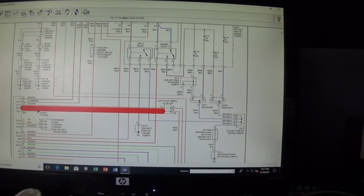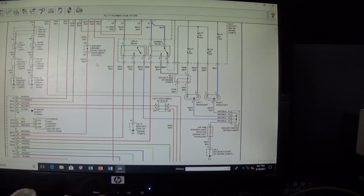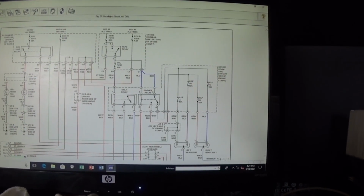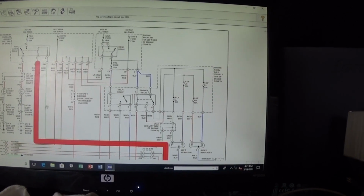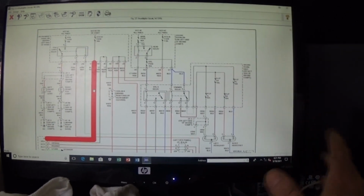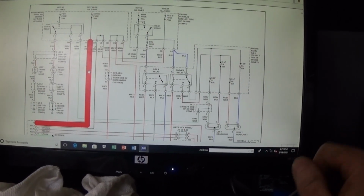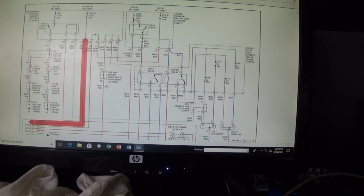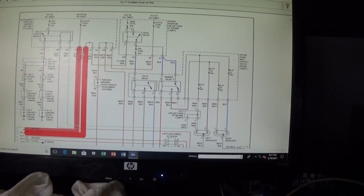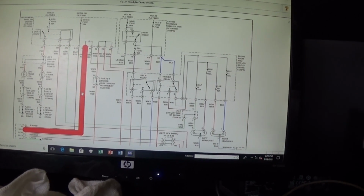So anyhow, you can see here from this wire, it's basically the same wire that is supposed to turn on the head relay, so it's this wire here. So once it receives the signal, which the body control module is receiving, to cut down the diagnosis, I checked all that and it's fine. It's basically receiving the signal. So here it's supposed to go through, actually this is the ignition, this wire here, I'm sorry.